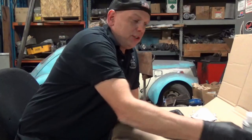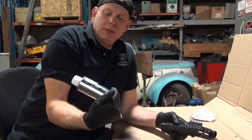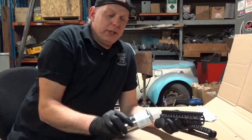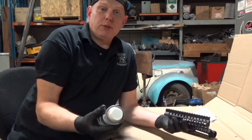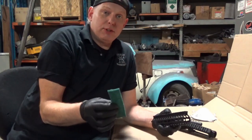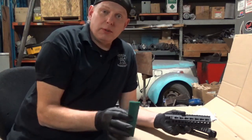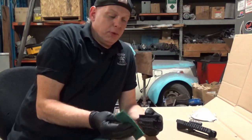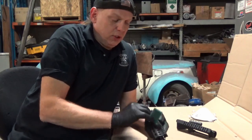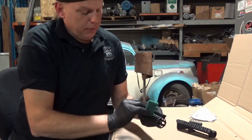Per their instructions, you're supposed to degrease it with their True Strip and then sand it. But that's going to be a waste of True Strip because then you have to spray it again. So I'd suggest going to the Scotch-Brite first. Once you get all that dust and dirt on it, you can spray it all off at once — one and done. So we're just going to take some Scotch-Brite and rub all those surfaces until we lift them up just a little bit.